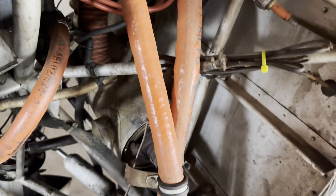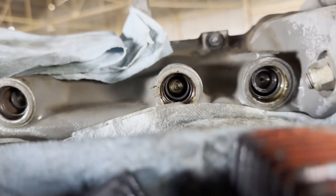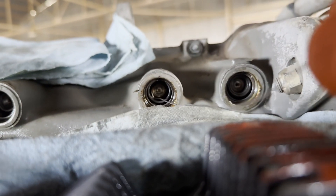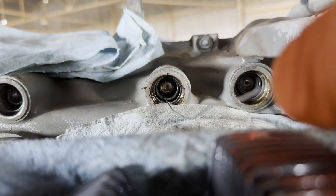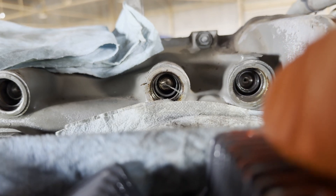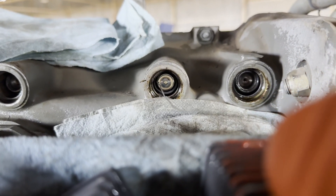I've got a piece of 032 safety wire that I have bent a hook onto the end of. You can get a very similar tool to this from Lycoming. I think the last time I checked the price on Aircraft Spruce it was about $250 for this little thing. Or you can just get a few inches of 032 wire and use this.